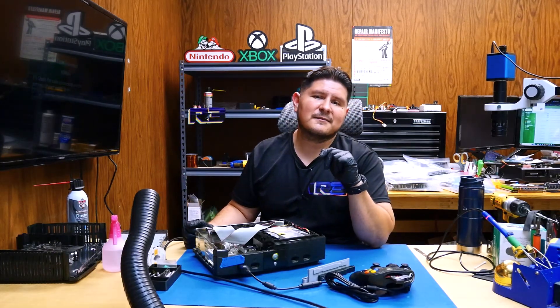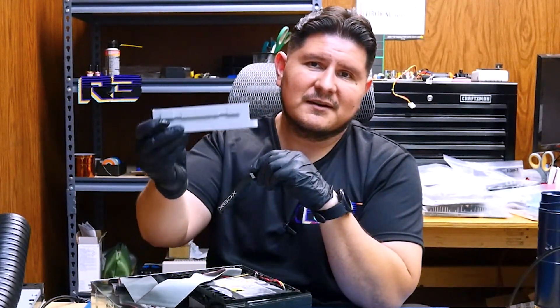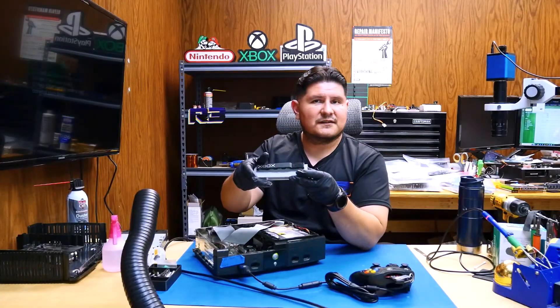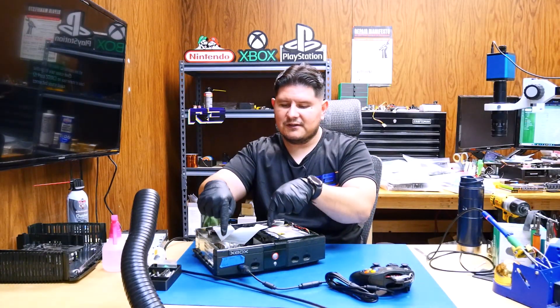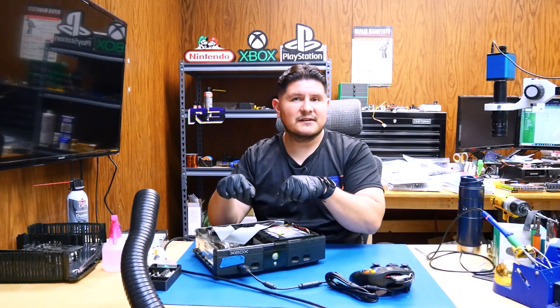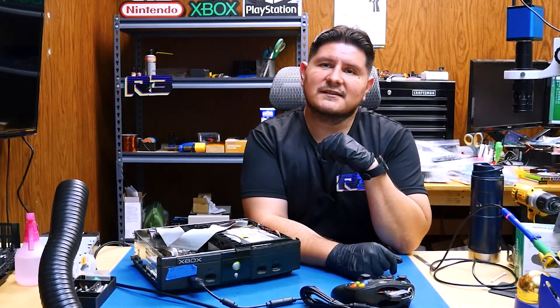I'll probably be installing the Stellar into this console, but that's not going to be in this video since I've already shown that a couple of different times. The last thing to do is to remove the bezel from the DVD drive and install it onto this 3D printed platform — it just snaps in just like that, and it will go right here. Use the two screws that held the DVD drive to attach this 3D printed piece, then you can seal up the console and it's good to go. The DVD elimination project can be found on GitHub and is created by Wired Opposite. A link to the project can be found in the description below. If you found this video helpful, please remember to leave us a like and subscribe — thanks for watching, until next time.